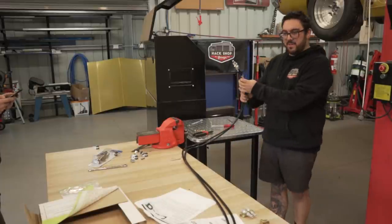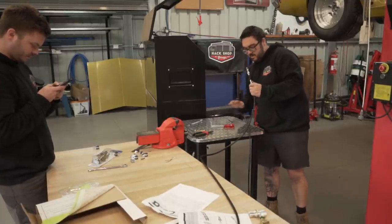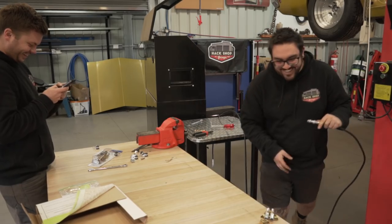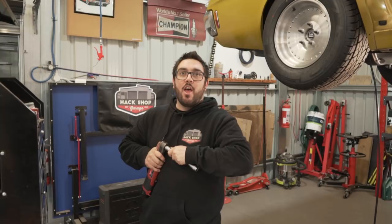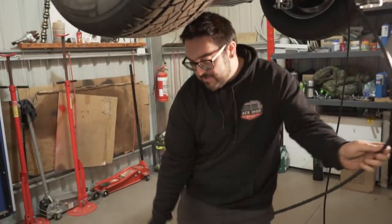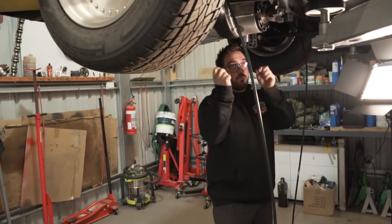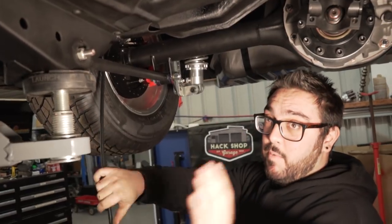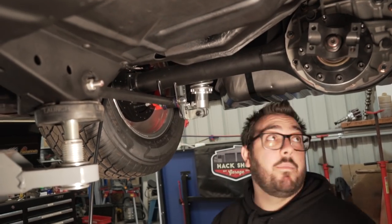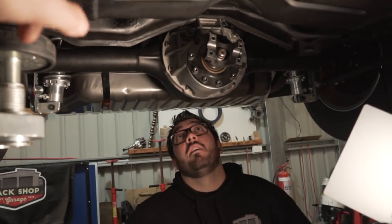This is a freaking long cable. Before bolting the outer sheath in, I pulled the cables out, so there's no cable in there at the moment. I'm going to bolt this in tight to each side and then route it to where we want it to go. I'll cut the sheath back to where we want it, then put the cable in and cut it down — we want a bit of play so we can tighten it. We think the easiest routing will be to go over the top of the diff and then come forward.